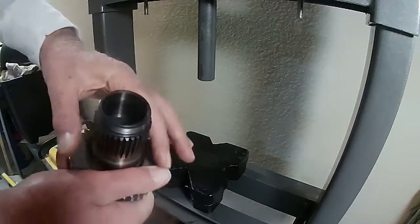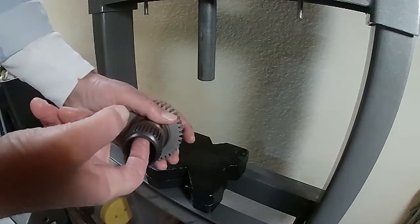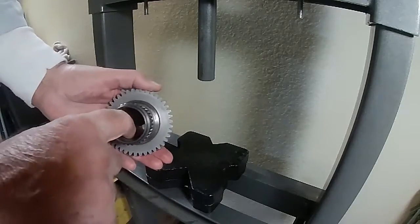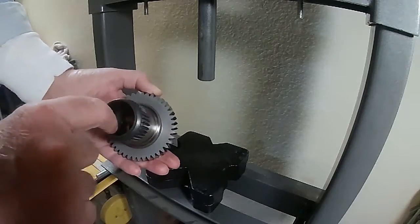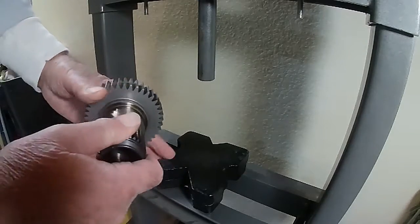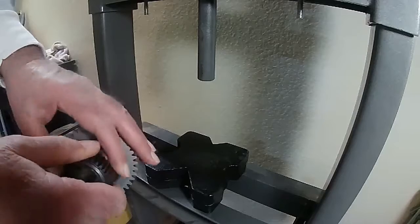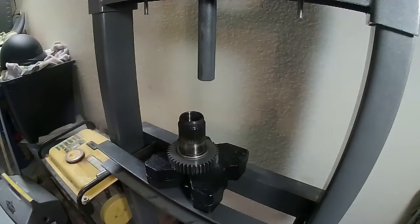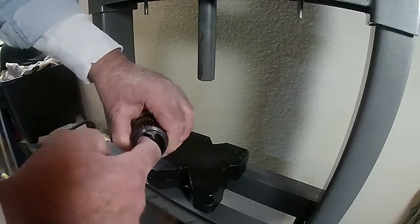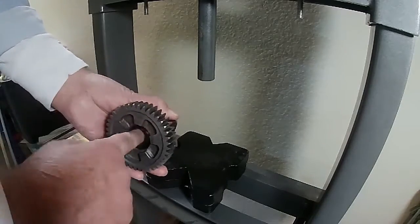Check inside — you run your finger along there and your fingernail, and see if you can catch any spots that will catch your nail. If there's none, it's good. Now you'll feel a spot in there where the bearings are separated — that's different, it's not as smooth. And that's normal, that's the way it's supposed to be. So now what we'll do is take some oil and coat the inside with oil, and we'll get the bearings installed. Put a nice thin coat of oil in there on both sides.